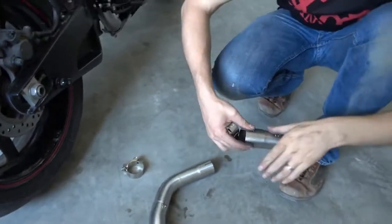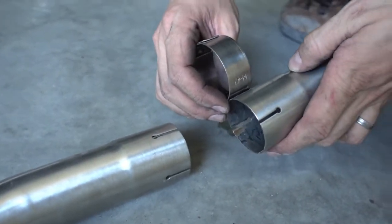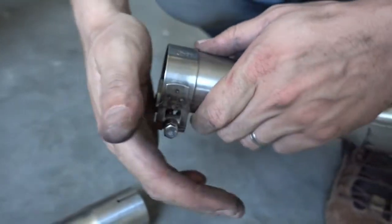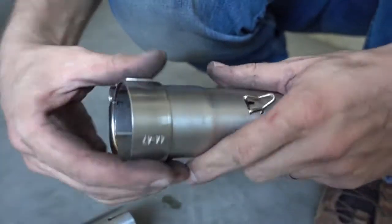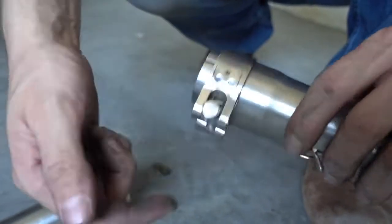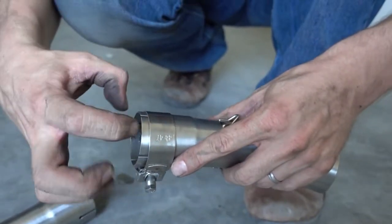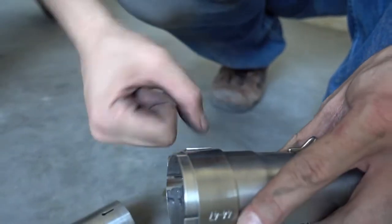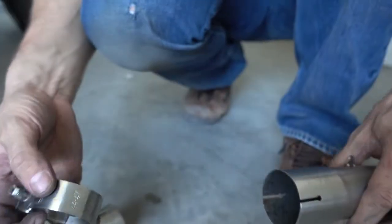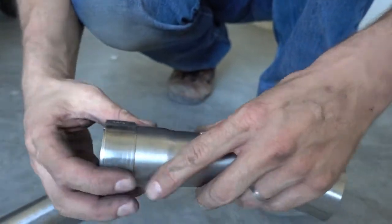With the mid pipes, you can see there again, they have some little cuts on the end. And the cuts are just as wide as the clamp is wide. So you have to put the clamps over here and make sure you leave the clamps on the lower end. If you put the clamps up like this, you can tighten them unlimited, but the only thing that happens is the bolt will break. Because in this way, the clamp can't squeeze down the pipe, and you can tighten and tighten and tighten. It will always be loose, and one moment the bolt will break, the pipe will never be correctly in place. So make sure you put them just on the end of the pipes, not further.